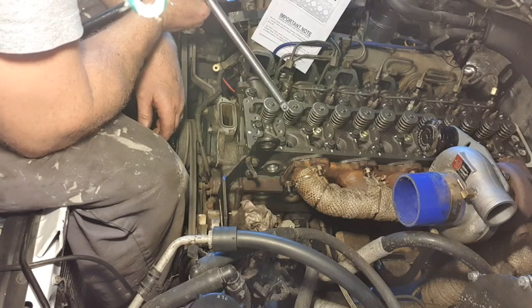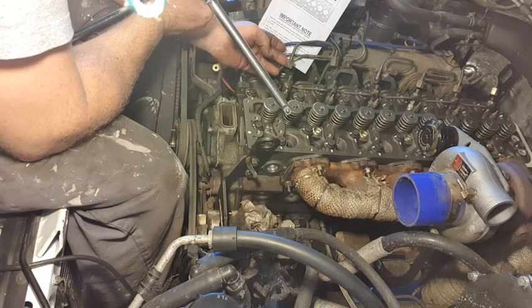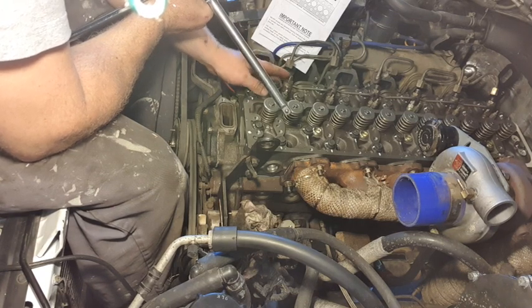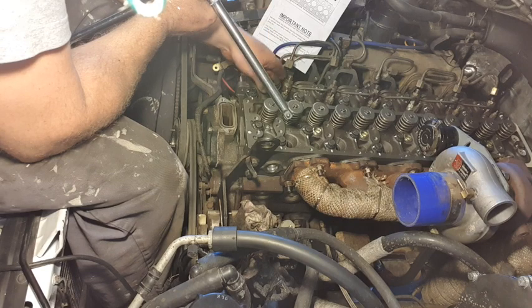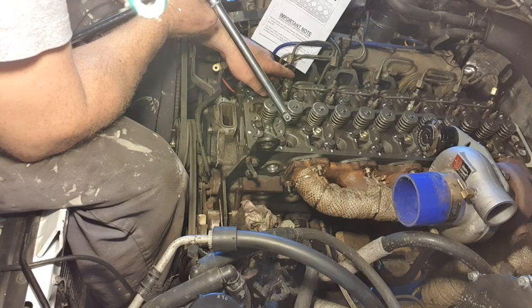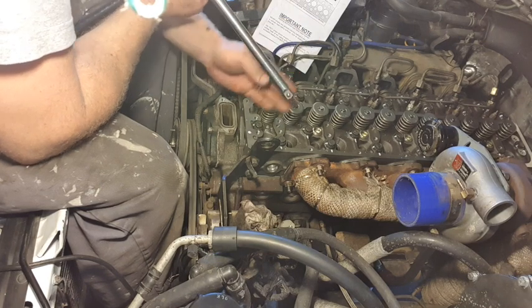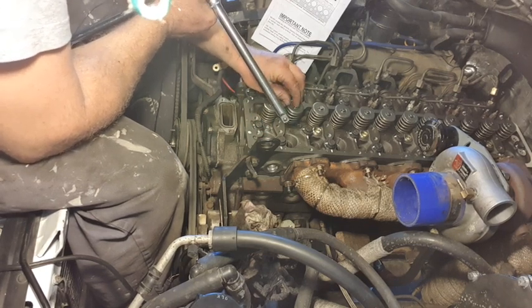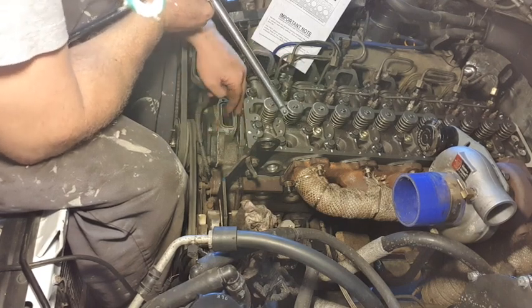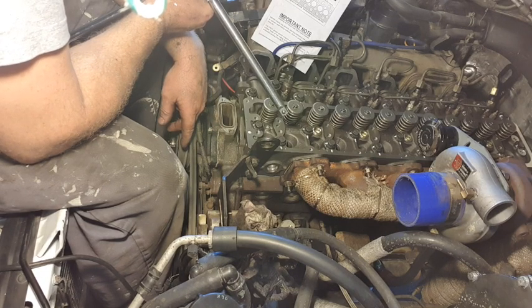So the next thing would be to put the intake manifold back on, all the injector lines. I'm just thinking I sort of want to get to the injectors as soon as possible, because the longer that these are off, the more opportunity stuff has to fall down these holes. It's probably not the right order, like usual, but anyway, I'm going to do that. Then I'm going to come over, do the rockers and what have you. Install my thermostat housing and just put everything back together.